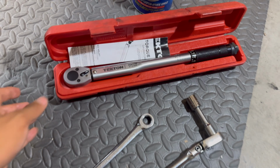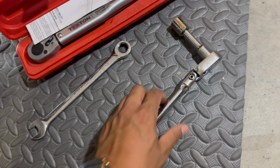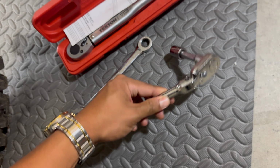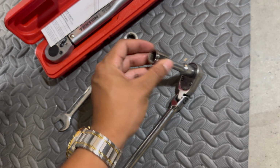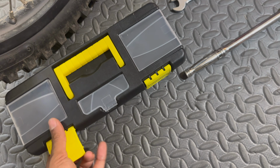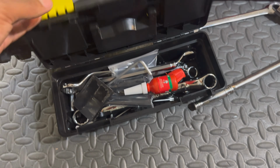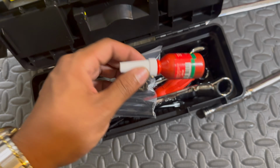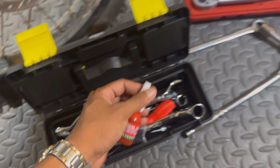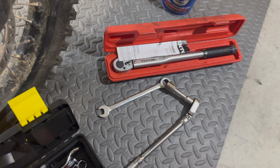So if you recently purchased a Rawrr Mantis X, make sure you check the torque specs on your rear suspension. To do this, you're gonna need a 3/8 torque wrench, a 13mm wrench. I'm just using a 3/8 wrench with a 15mm socket and extension, some multi-purpose grease, and some blue Loctite. Luckily, this Rawrr toolbox toolkit that came with the bike actually came with some Loctite. But if you are interested in checking out any of the tools, if you don't have them, I'll have them linked in the description below.